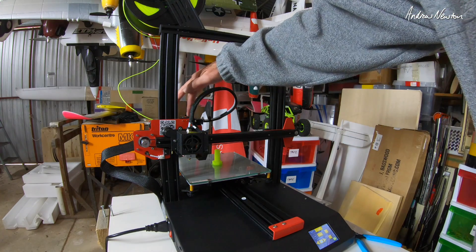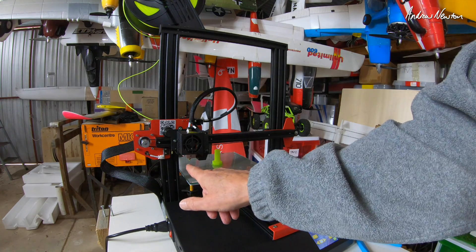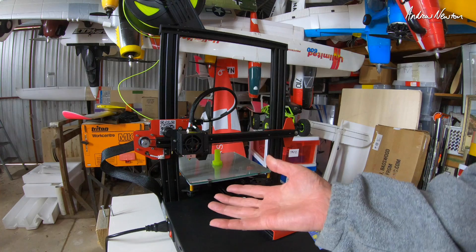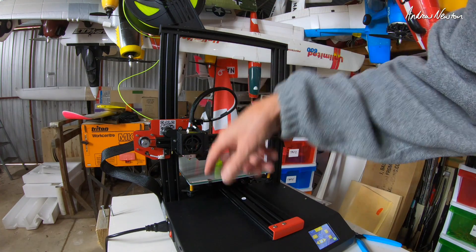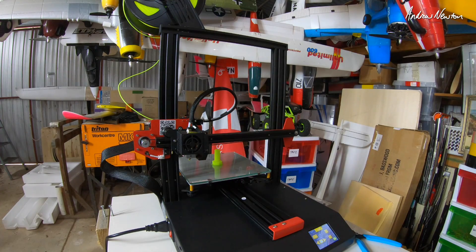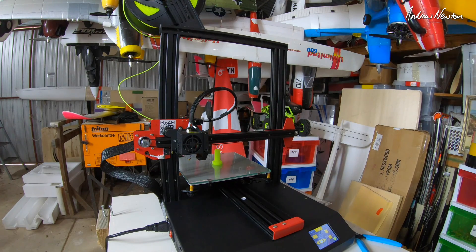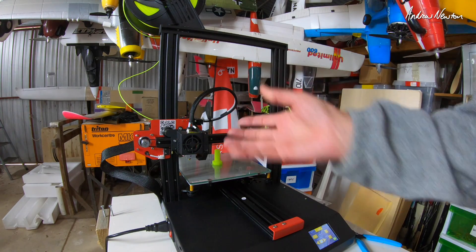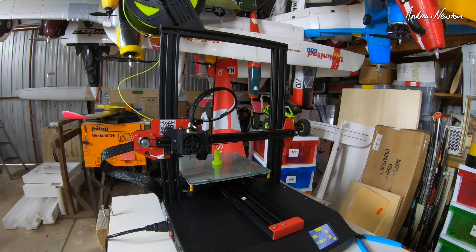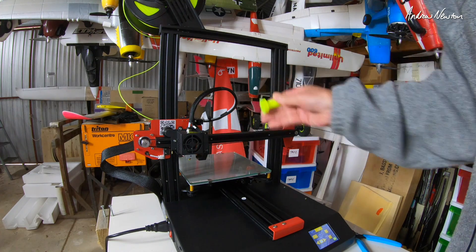So let's load it again — that will load back in 30 centimeters and get it right to the nozzle. If you don't do it this way, or you don't manually make sure the nozzle is primed, it'll start printing without any filament coming out of the nozzle. I'm getting ready to start another print so I'm putting the SD card in the slot. This is why I like doing it manually — it's way quicker and you know that the filament is all the way through to the nozzle.